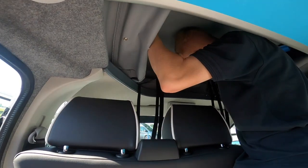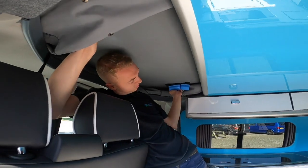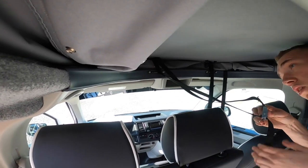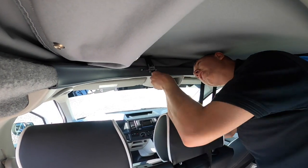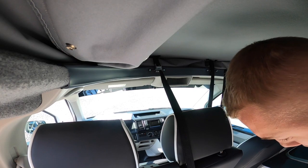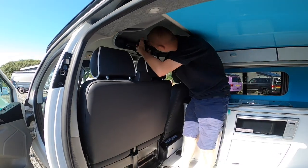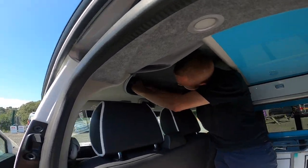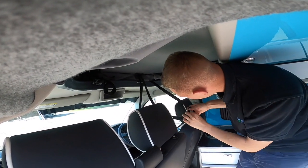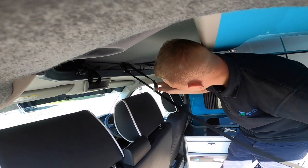Roll the roof over at the front and pull it all the way down until it rests closed. Then use the straps provided — slot the strap through, tighten it up, coil the excess, then go around the head of the strap again and tuck it in, rolling it through a few times. Do exactly the same with the other strap to secure the roof down for traveling.